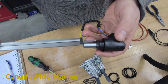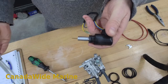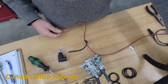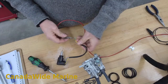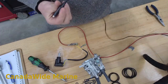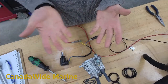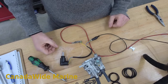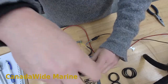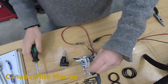Come in nice and close there so you can see what I'm measuring — measuring that height. Now we're going to take 12 volts from our battery here. I've got a little test battery up here. Connect one wire there, the other wire here. Now this takes a couple of minutes, just like warming up your motor. You're not going to see that move — you need to actually measure it. While we're waiting for it to warm up, if it's cool in your shop you can actually feel it get a little bit warm. Doesn't get hot, just a little bit warm.